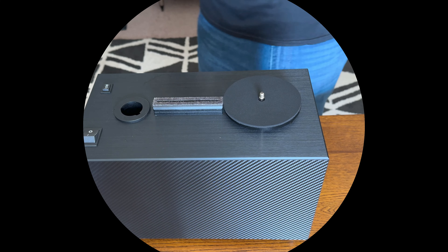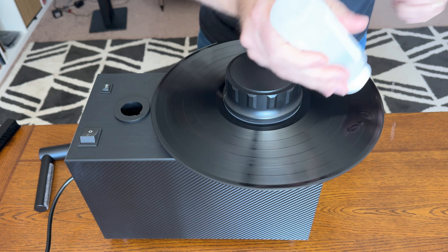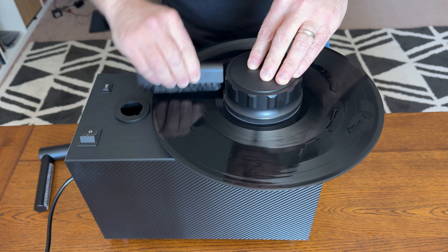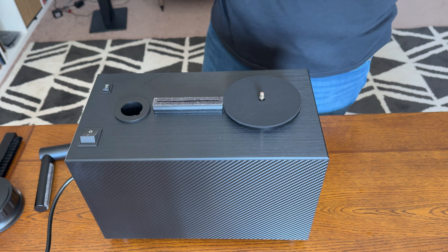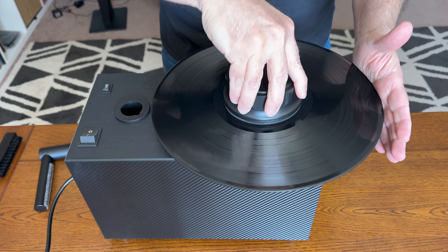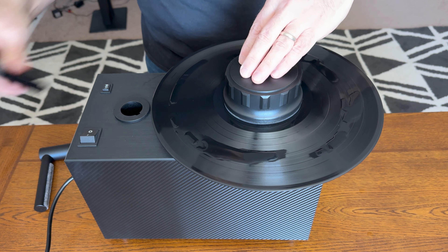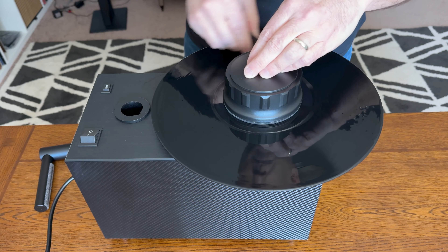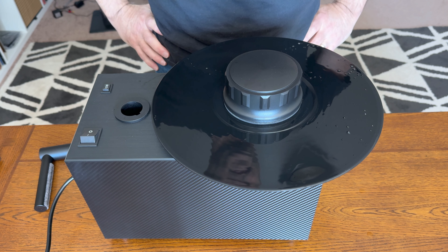Now let's go straight to how this thing works. If you're familiar with the Record Doctor 6, there's really not much of a learning curve here. You place the record on the platter and spread the fluid around using the brush. You can turn on the motor to help with the spreading, but really only on the first side, because when you flip it, it comes into contact with that sweeper strip, so you have to spread it around manually. The top clamp looks just like the Record Doctor 6's but it screws on. After you've spread the fluid on both sides, it's only a matter of screwing the clamp down. You do need to make sure it's screwed down really well, or it won't overcome the suction from the dual vacuums. The vacuums are pretty strong — stronger than the Project, even stronger than the Record Doctor 6 — and it makes sense because there's two of them. So ensuring that clamp is tight is key.